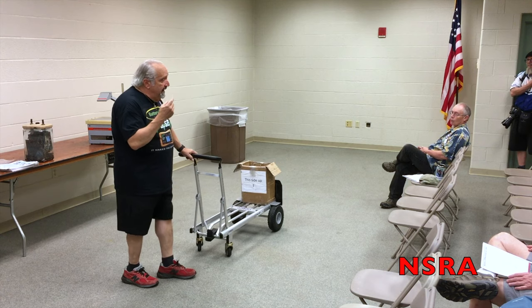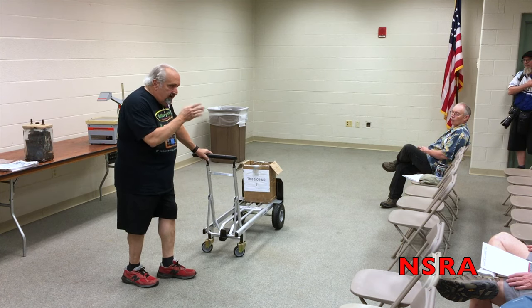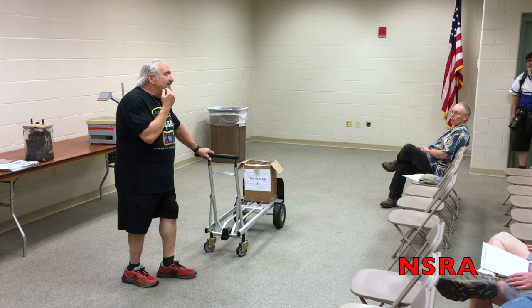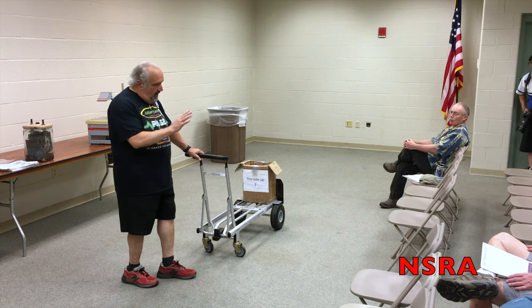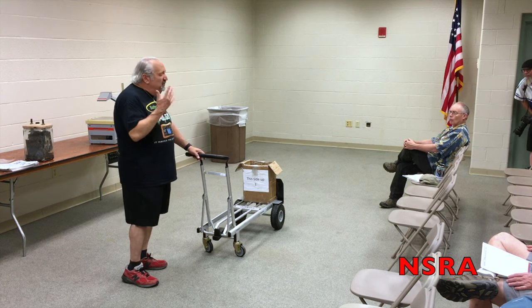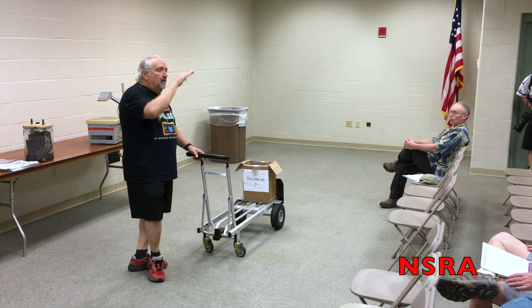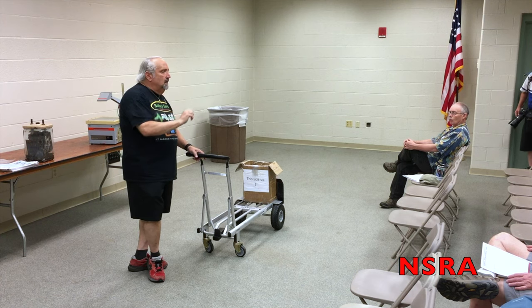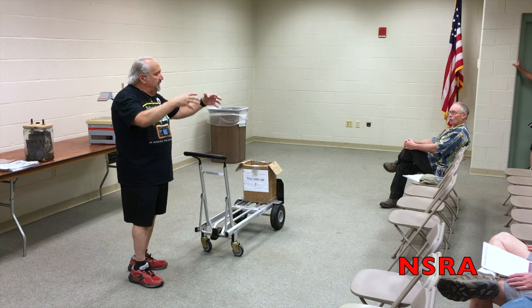Two things about maintaining batteries, too. If you keep the voltage up, you're not going to get as much hydrogen gas. And if you keep the level of a battery up, now I'm talking about maintenance or non-maintenance batteries, old-fashioned batteries, keep them full. Don't let them go down, because the hydrogen gas gets trapped in the top part of the cavity. That's where the hydrogen gas is hanging out. Also, it's hanging out around the plates.